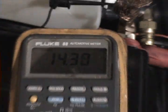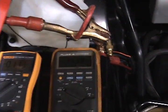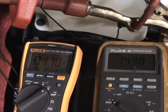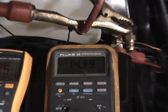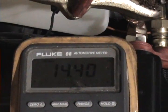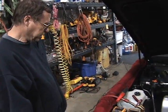Now I'm going to connect this and we'll see the additional increase and the amount of current. So 10 additional amps are being supplied by this wire, which is enormous, but it's made very little change in the actual battery voltage. And this is a worst case condition here. Go ahead and turn your headlights on and the fan, Jim. Now we're going to do an absolute worst case — we're going to turn the high beams on and the fan, which are the two things in the car that draw more current than anything else.